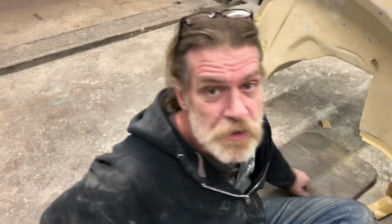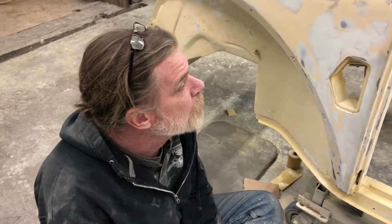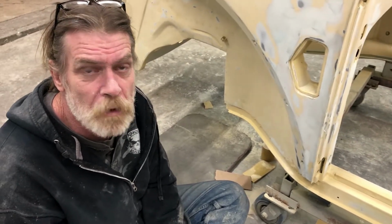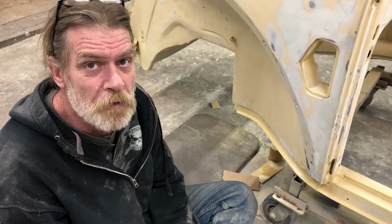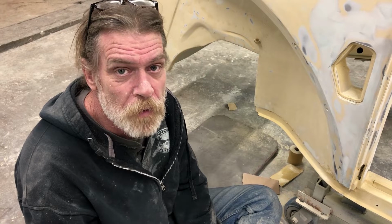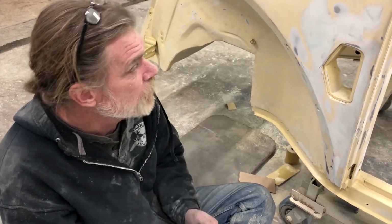So, this is David Range's 52 Zwitter. Hi, Dave. Last week, I think we were doing rough filler. So we got it back into high build. I cut everything down to 180. We're going to do another run of high build. Being this is one of our top end show cars, we want it to be nice, shiny, straight, and smooth. Now make sure we didn't miss anything.